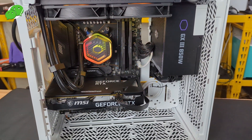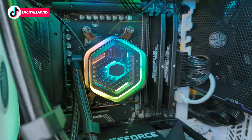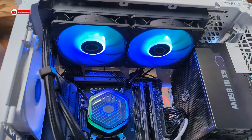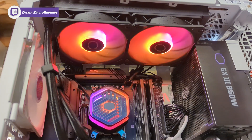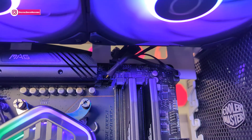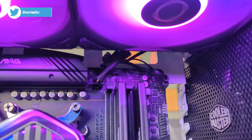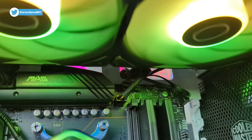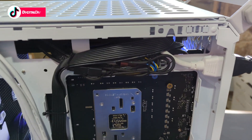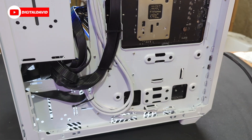Nice little feature, depending on what you're trying to accomplish. Gorgeous — look at that. Looking at the very top, our radiator with our two installed fans — beautiful RGB. They're very quiet and very bright, a perfect complement and accent for our build. You'll also see our connection options on the motherboard and how we routed everything: RGB to one header on the right-hand side, and on the left-hand side we have two headers for our CPU fans and our pump. On the backside, everything is tidied up and tucked out of the way, with the rest of the cable down at the bottom.